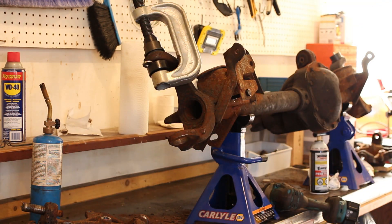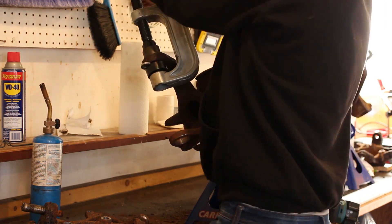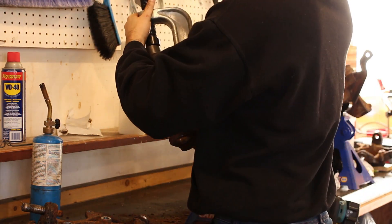If you are struggling to get the top ball joint lined up, you can get a couple of washers to shim the collar. This is where the tapered collar would have helped, but again, it's not really necessary.